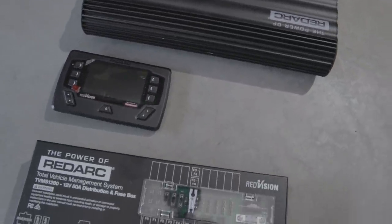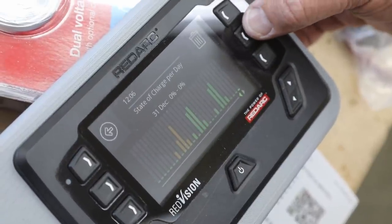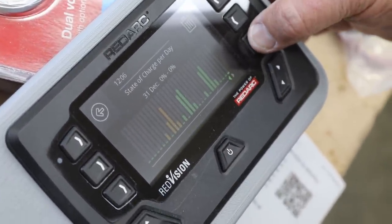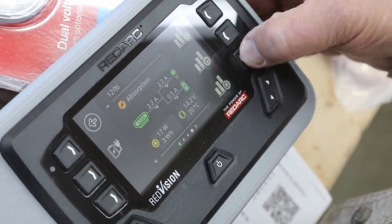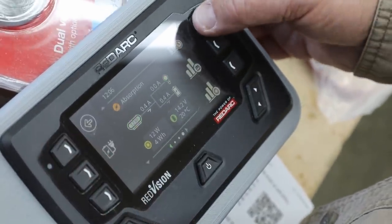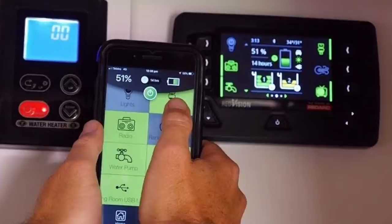The Red Vision system is total vehicle management. You can program all your soft keys and all your accessories — your lights, your winch, your spots, your floods, your refrigerator, anything you want — into the Red Vision, and then through that control panel you can turn them on and off. But it's way more than that — it also gives you all the stats and the health of your system: how much you're currently drawing, how much you're currently charging, how long your vehicle can sit without charge until the house battery is dead. It isolates your starting battery, has a configuration app and a control app to control your vehicle through Bluetooth. I'll leave links in the description.